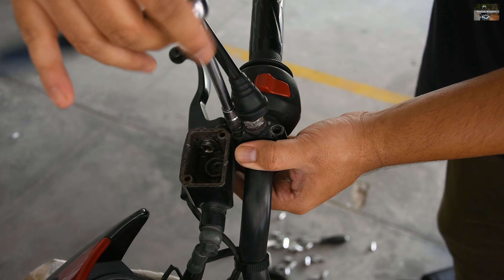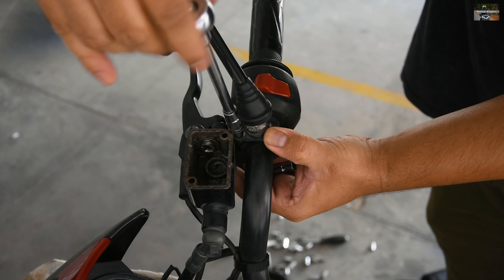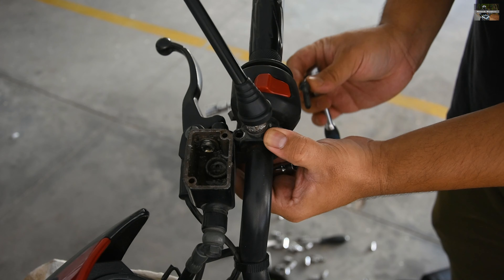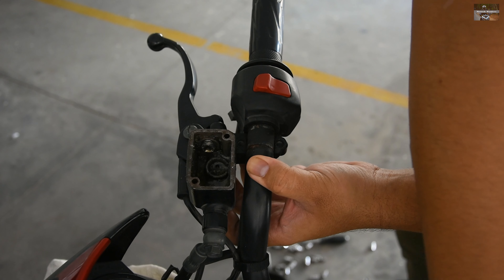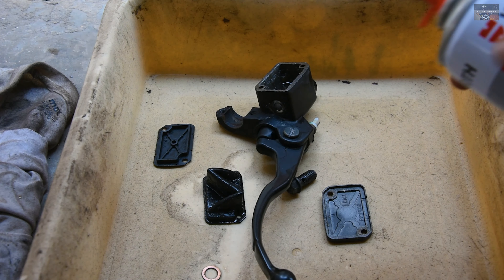By the way, the bike was already running DOT4 type of brake oil. I have already used DOT4 about six to eight years ago when I changed it. Now we will add DOT4 again. We are not going to mix DOT3 and DOT4 when it comes to brake fluids. We will continue with the DOT4 fluid that was already used in the motorcycle.